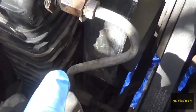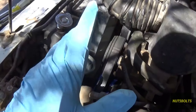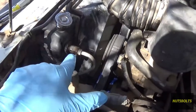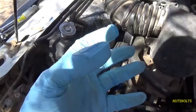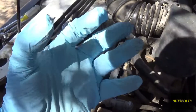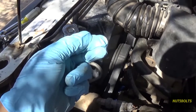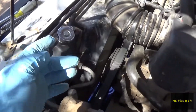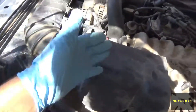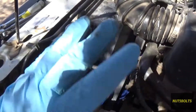After getting those two things sorted out, I drove the truck around and saw a leak somewhere around the radiator. It wasn't a consistent leak — it would only happen overnight. When the truck was driving it wouldn't leak, which told me that while driving and it got warm, the plastic would expand and hold itself tight, then once the car cooled down, the plastic would relax and leak through. The cooling system pressure tester lets you test the system without the engine being warm, so you can diagnose these kinds of problems.